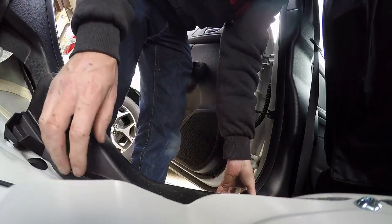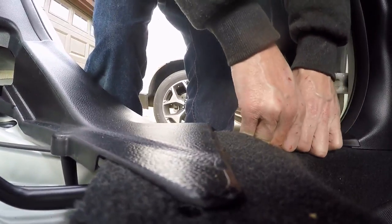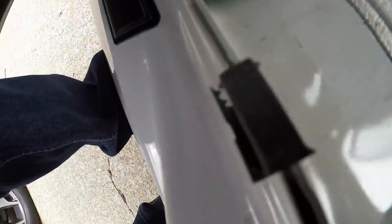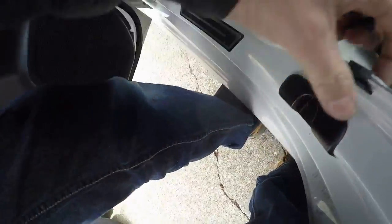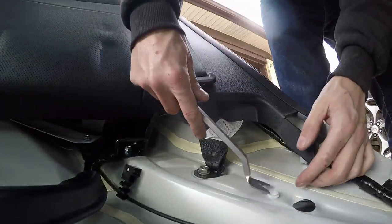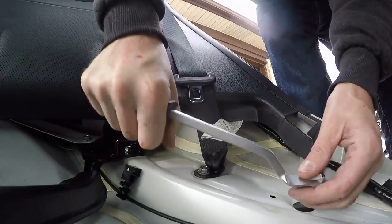I'm not going to disassemble much, but I do want to disassemble this just to get the edge here. You just pull up fast so it doesn't break, then slide it, and get the clip out. Both clips stayed so I've got to take those out and put them back in the appropriate spots. Be careful — these things are sharp. I'm going to stop and be smart and get gloves so I don't slip my hand open. I've got a little fork tool here — I twist side to side and pop out these little pieces — perfect.